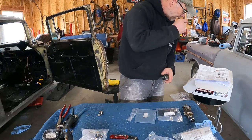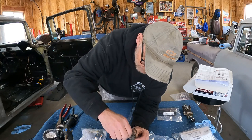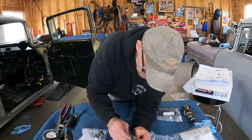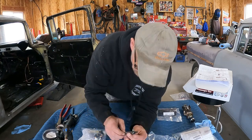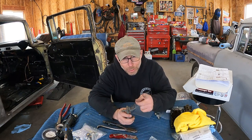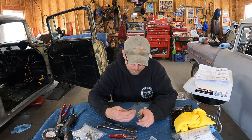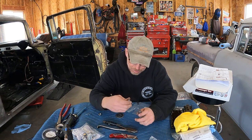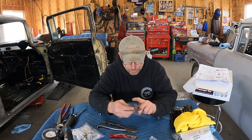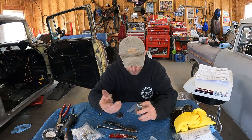Cluster ground — took care of that on the cluster and the brake switch. Hold on — I'm back because these little things actually do unscrew off the back of this switch. Let's see what we find. Spring — it comes apart. Still no access to cable. There's a hole in this side — I wonder if it just installs through there. I wasted enough time going down that rabbit hole. I can't figure out a way to get this cable off here. Was this a washer button that would squirt fluid? There's like a little spring assembly in here. Anyway, if you guys know how to replace this cable let me know — otherwise these are usually around a hundred bucks and I'll probably just hook it up to a toggle switch. We'll throw it back in there for now to fill the hole in the dash.